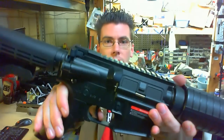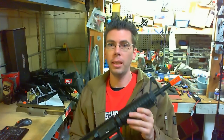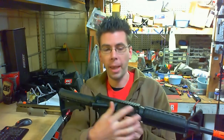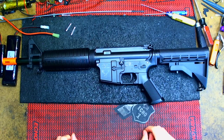And if I keep on pulling the trigger like this, it will pop the fuse, and it will actually cause more damage because all that heat, it's not able to turn the motor and the gears. It just backs up kind of like a garden hose and burns up the trigger switch. So please do not shoot it anymore. Let me show you how to fix it.